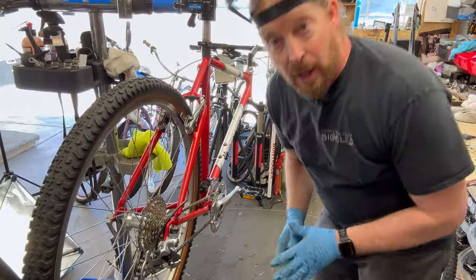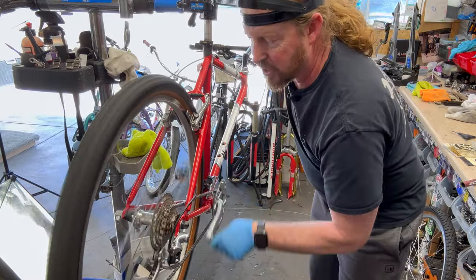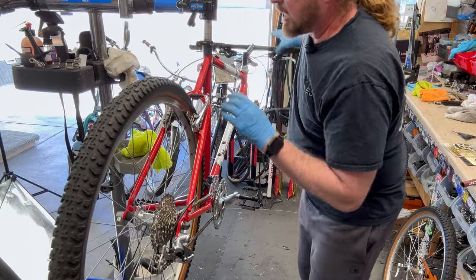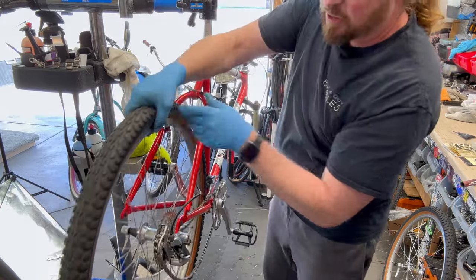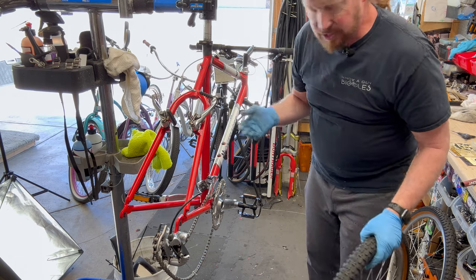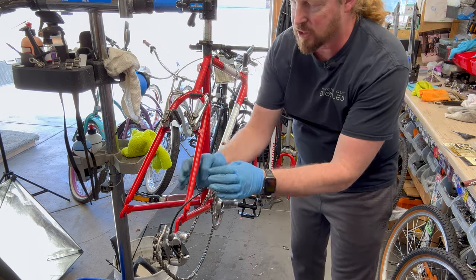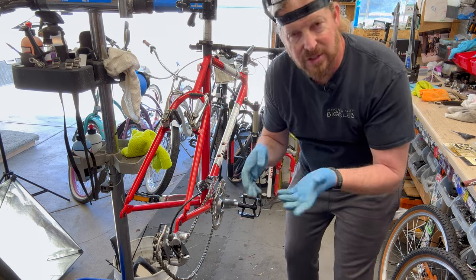Let's take care of the rear. Bike 101: knock that derailleur down to the smallest cog. That pulls the derailleur out of the way so the wheel can drop out. On the brakes, the same linear pull opens up, and with the quick release the wheel slides right out with the derailleur nicely out of the way. Hook the brake back up — don't forget those little things. Now we can get into all these little nooks and crannies.